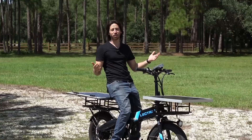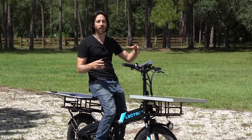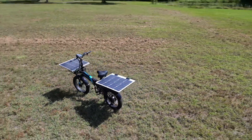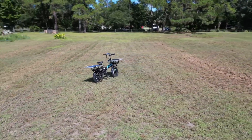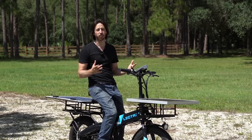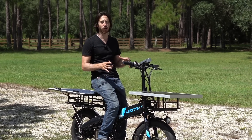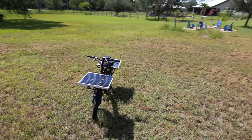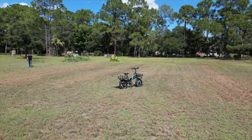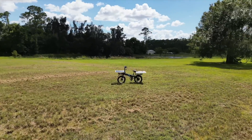Thanks for watching. I was able to take two 50-watt Renogy panels, outfit them on the bike, and get almost 80 watts of charging — not quite as much as the stock charger at around 100 watts, and certainly less than the bike uses while riding, which averages 350 to 500 watts and up to 750 watts at full throttle. But at 80 watts, parked outside for seven or eight hours, I could get a full 500 watt-hour charge on this battery — so I could theoretically charge this bike every day from the sun.